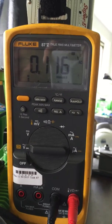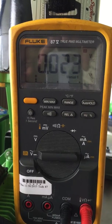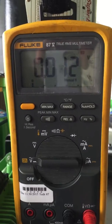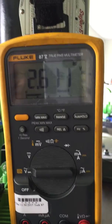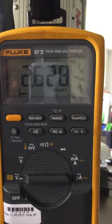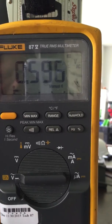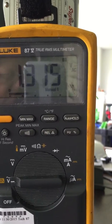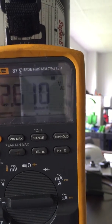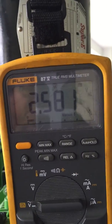In a stop condition we should be reading approximately zero volts on the multimeter. Now I'm going to start the motor and we should see the volts go up to around a maximum of 2.5 to 2.6, and that's testing the Hall Effect cam sensor. It's telling me that the magnet is passing by the Hall Effect sensor and inducing that voltage.